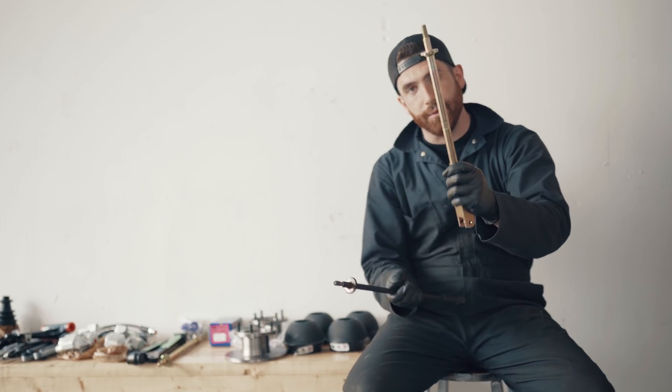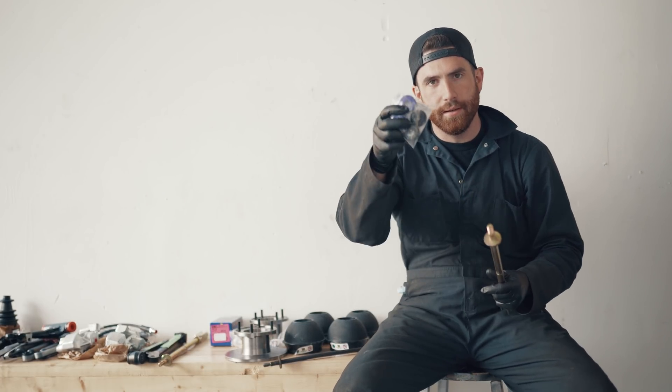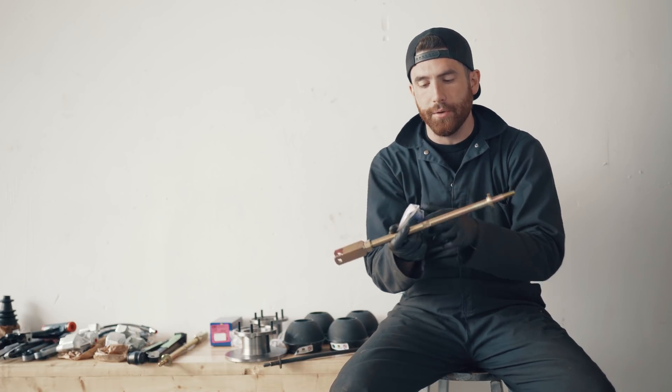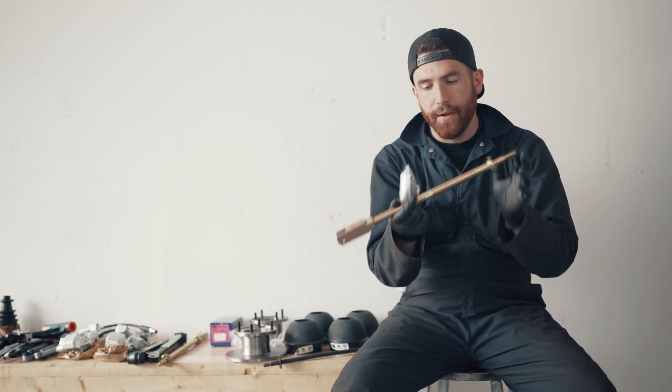When we use these, we like to use this set of bushings. There are two bushings per rod in the kit: a purple one made of hard polyurethane, and this black one here which is rubber. The reason you have two different durometers — or stiffnesses — is because the arm needs to move up and down but also needs to prevent the wheel from moving forwards and backwards. You put the stiff bushing on the outside to prevent fore-aft movement, and the soft bushing on the inside to allow up-and-down movement.